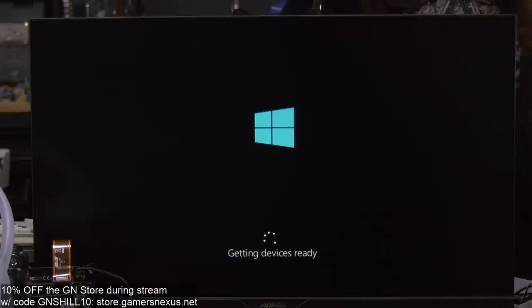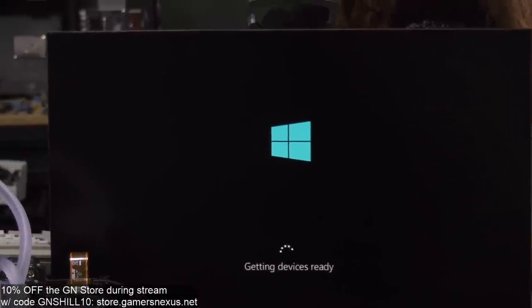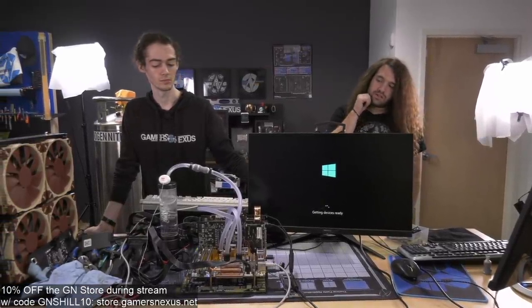I'm not sure what the question's asking. Green and black will jump the power supply, if that's the question. When would you jump a power supply? It would be if you're troubleshooting, trying to see if the power supply works at all, independent of a system.